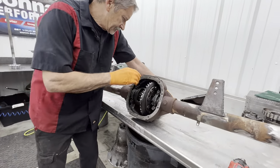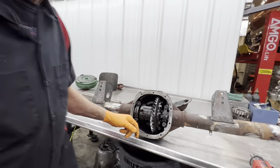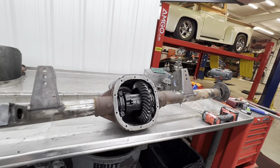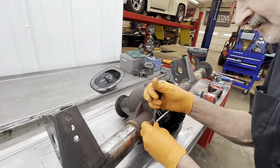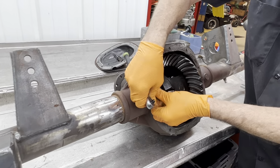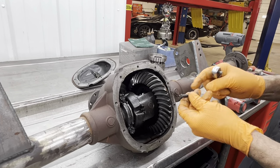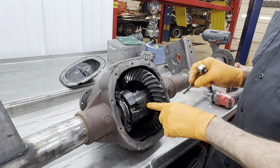Normally I have these rear ends turned over, and what I'm going for is this little eight-millimeter bolt right here. These bolts are usually loctited in if it's done right. It was loose, so he might have been messing with this to start with. Anytime you put this bolt back in, you'll loctite it. You want to make sure the end of this pin right here is good, because this is physically what holds the pin in here.